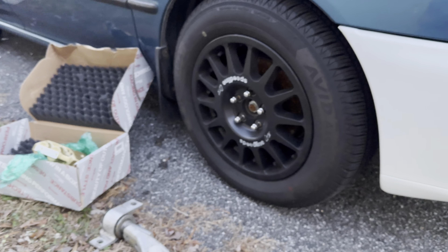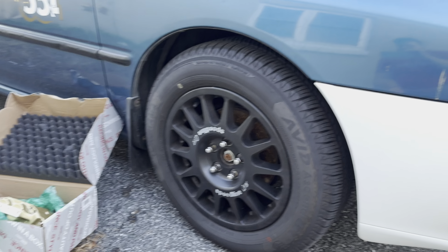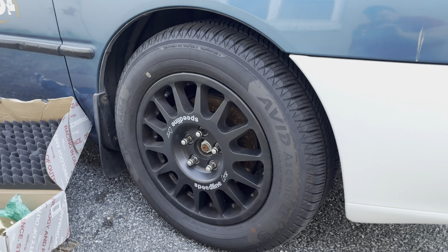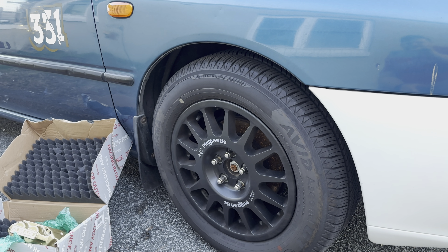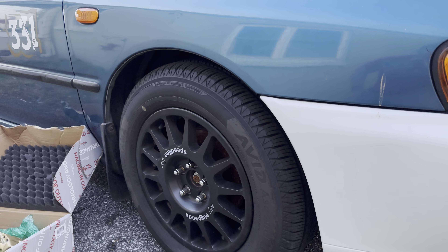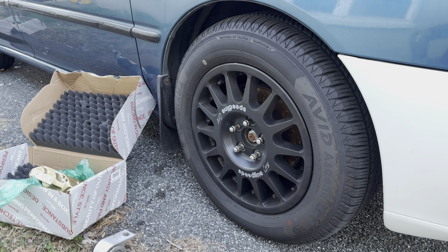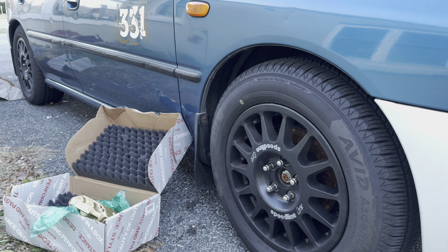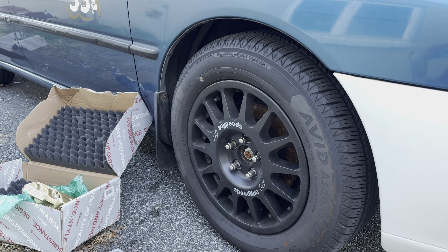But you do scrape if you have 15-inch wheels. I don't know that you'd have this same issue if your car was still at factory ride height. Mine's a little bit lower than factory because of the Eibach springs. Also, if you had a 17- or 18-inch wheel, it might not even be an issue. But with 15-inch wheels, I get rubbing at full lock, which I try not to do very often. But sometimes depending on the geometry going down an embankment or how quickly I'm turning, they'll scrape the inner wheel. And that's not fun.